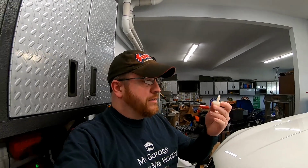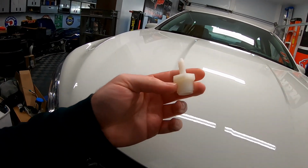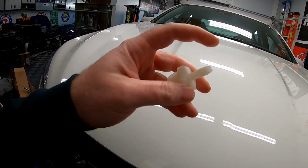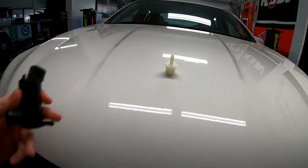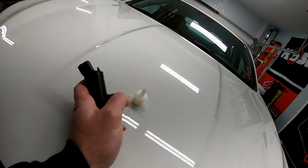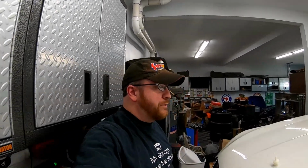I'll try to include a part number or a link to one of these down in the description below. But basically what we have here is a 1/2 inch NPT thread to a 1/4 inch hose barb adapter. So what we're doing is using this 1/2 inch end and connecting it with a hose and connecting it right here. So that will look like that. And what we're going to be using is actually left over from the heater hose relocation.